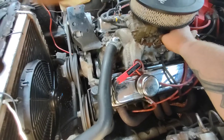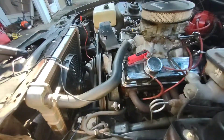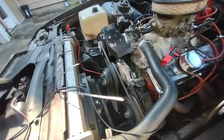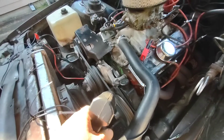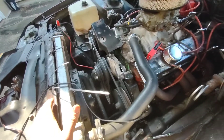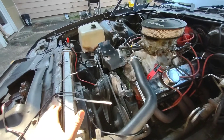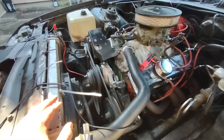Let's clean it up a little bit. Well, that's all set. The leak's not — we've got to finish that up. Where are we sitting now? It's at about 7 degrees at idle, which I mean is okay I guess. We're mostly looking for total timing — that's where we're having the issue. At idle I can deal with it being a little off.